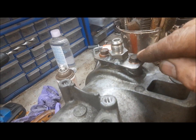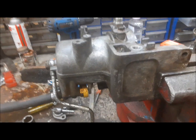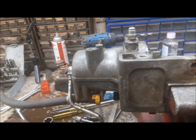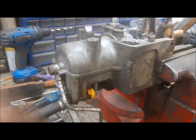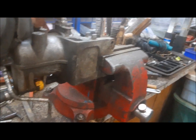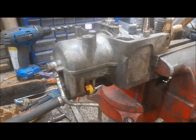And now we've got a little more room here so we can attach it with normal cap screws, not those darn Allen bolts. A lot of guys, when they put the big pump and filter unit on the back, will just bypass this thing and get rid of it. You can do that — there's a little filter delete block that you get because there are still a couple of connections that need to be maintained. But I'm going to keep it in there. It lets me keep this filter here, which is kind of the last line of defense. And on top of that, the fuel heater is in here, and the water and fuel sensor is in there, although no water should make it here anymore — it should stay in the water separator at the back.